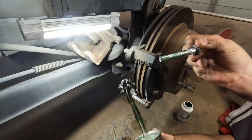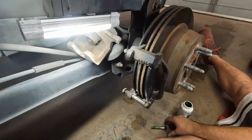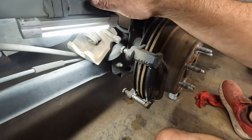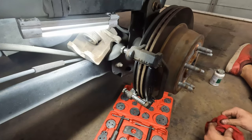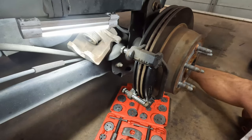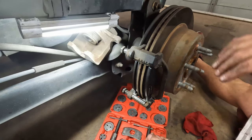Just give it a nice even layer as much as you can. Now we've got to squeeze that caliper back in. So this is that brake kit I was talking about — it has a bunch of different plates that connect to the piston. Some of them you have to rotate back, some you just push back. This one you just have to push back. Get one of these plates and use an old pad — push it up against there and just crank it back.